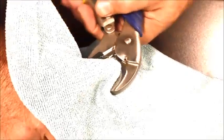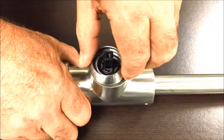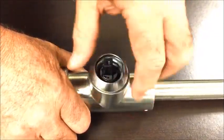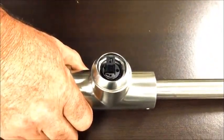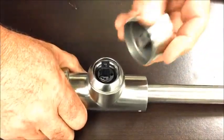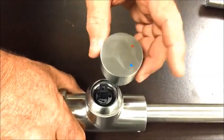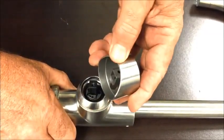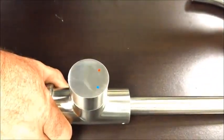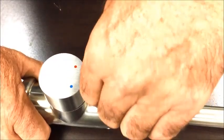Use your microfiber and snug up the nut, then put the ring back on too. You can probably just snug that up with your hand — you don't really have to get in there and make it super tight. Then take the cap, line it up, and make sure your two colored dots are facing upward toward the neck area. Feel for the little square hole, push it back on and into place, and you're done. Then just test it to make sure there are no leaks.